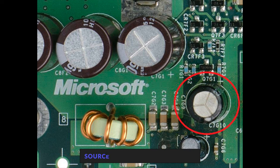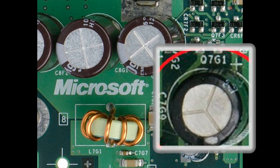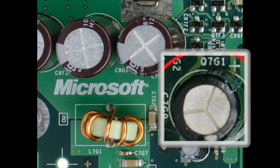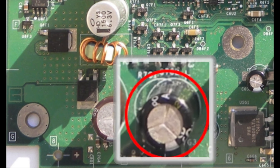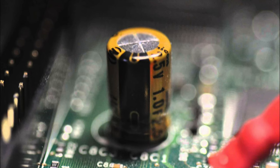The clock capacitor is located on the motherboard near the number one controller port on the front side of the Xbox. If you have version 1.0 or 1.1 of the Xbox motherboard, this is the clock capacitor you'll need to remove. For versions 1.2 through 1.4, this is the clock capacitor. And if you have version 1.6 of the Xbox motherboard, don't remove the clock capacitor — they're made of high quality components and removing it is likely to create functionality problems with your system.